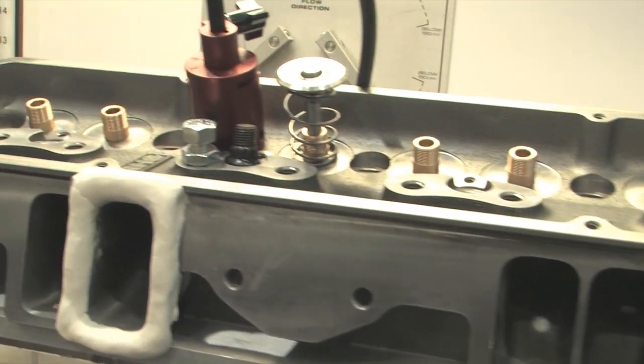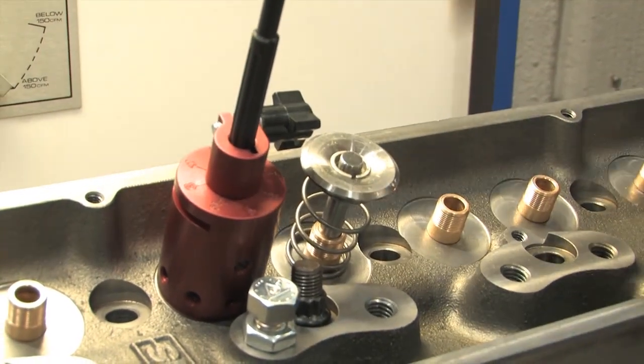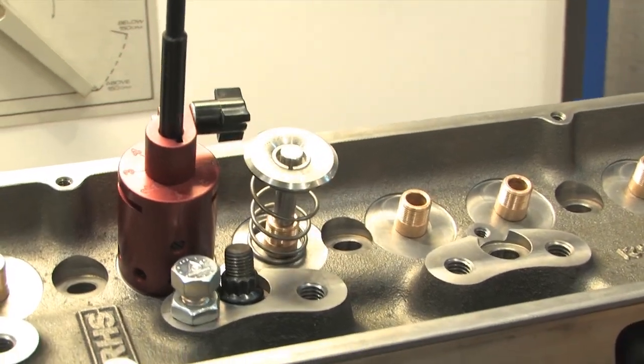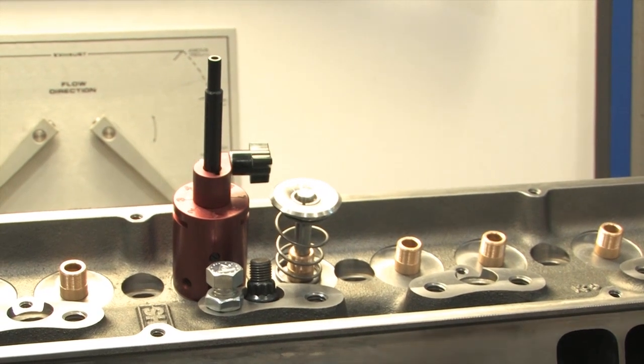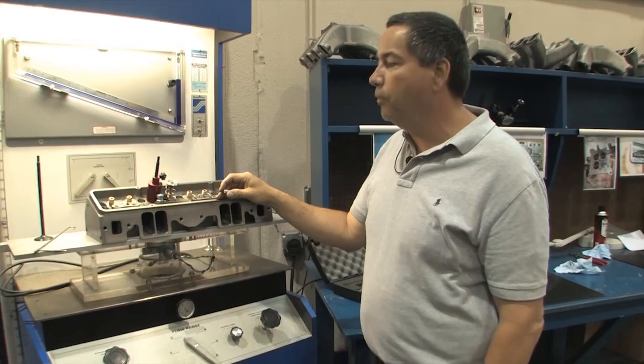Now with the main components of the hardware in place, Touchette explains the process: We will test all eight positions' pressure differentials, display them on our computer, and look at where the air is entering the combustion chamber and where it's not. Make changes and see whether we've improved our radial flow or we've packed all the air to one side of the port.